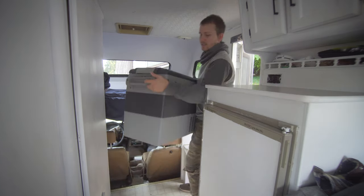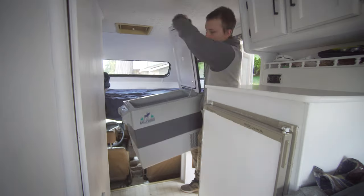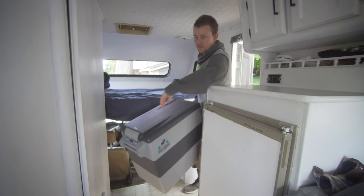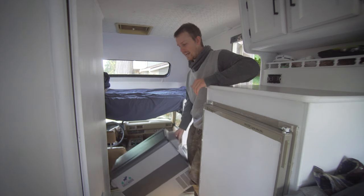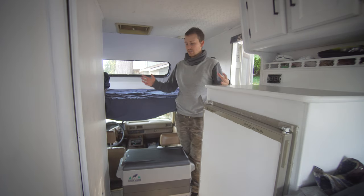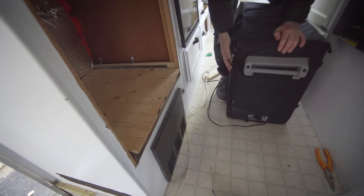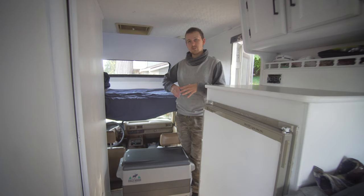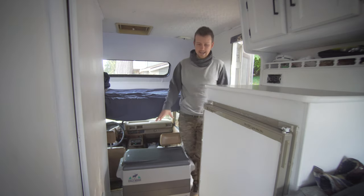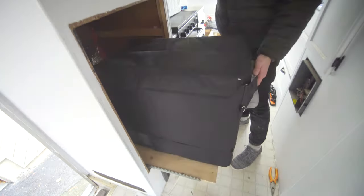So to solve that issue, I've teamed up with Chili Moose and they make this awesome compressor cooler. This is their 52 liter one and it's very well insulated. It's only a fridge or a freezer, so it goes all the way down to negative 18 degrees, and this uses a compressor. So once this reaches temperature, it actually shuts off and it only draws 5 amps at 12 volts. When it is drawing power, it uses half as much as the old fridge, and then once it reaches temperature it's going to shut off and just remain cool. So this was a great option and I'm going to show you guys how to take out this three-way fridge and install this instead.